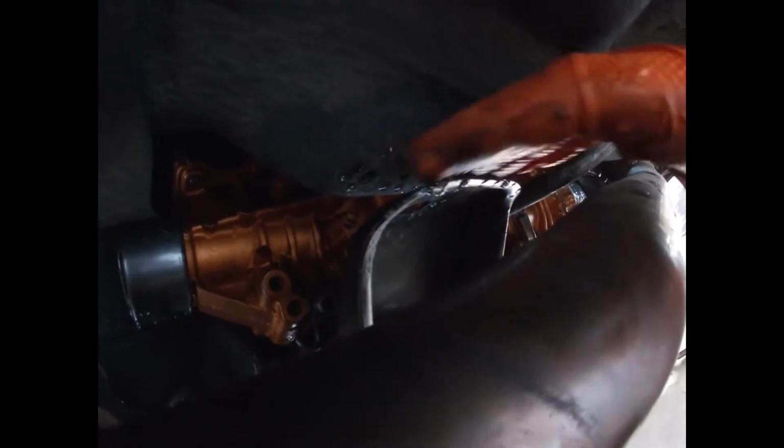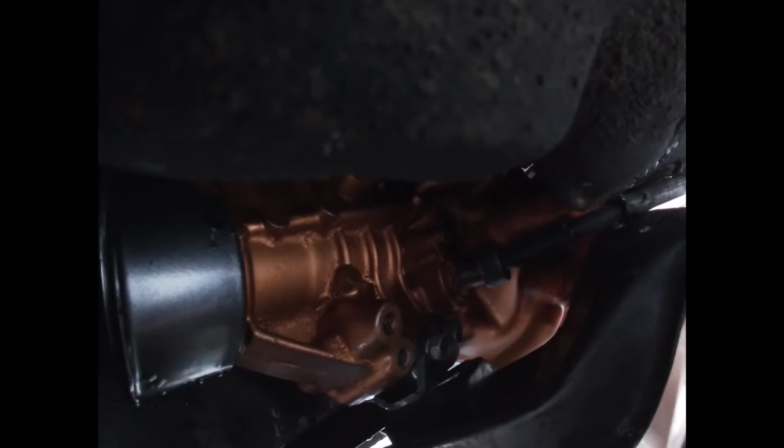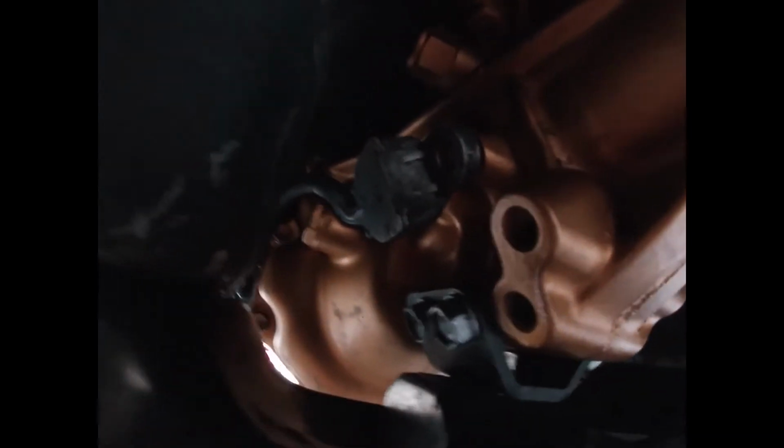And then I always like to leave this passenger side transmission mount open, so you can pass the speedometer cable through there and then thread it back in. It reaches. So yeah, once you have the cable lined up with the groove, then you go ahead and thread it in by hand. Voila. Yeah, so don't forget to put the sensor right here towards the rear of the transmission. I believe it's a 10 or 12 millimeter bolt that goes right here too.